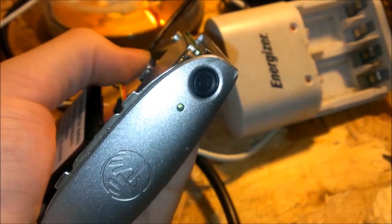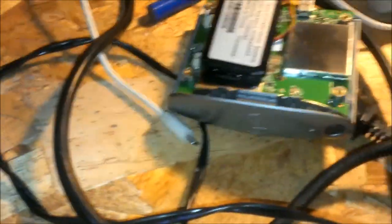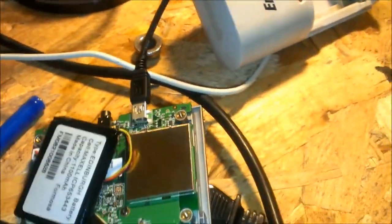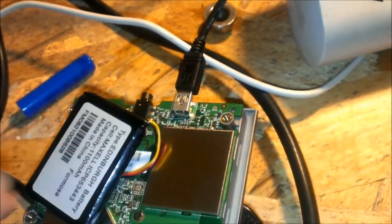It'll shut off because the battery's still weak, but if you push on this it'll turn back on and start charging. I'll do that in another video. But to jump these, it's pretty simple — just get yourself a battery pretty much the same voltage as what's in it. If it's a 5 volt, get a 5 volt. You may have to hold it on for quite a long time, then hurry up and plug it back in and put the charger on it. That's pretty much it. I'll do another video on fixing the solder connection. I hope that helped you guys out.